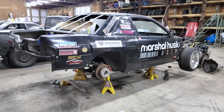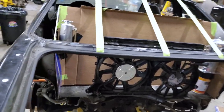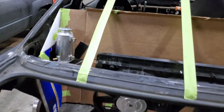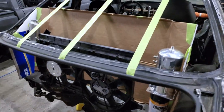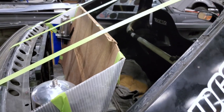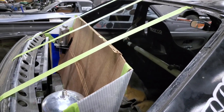I finished mocking up the firewall and I will show you that now. There are a couple of things I didn't do just because they're a little bit unimportant. This area here needs to be capped off in order to actually seal the firewall. I plan on mounting my surge tank inside of the radiator cutout along with the coolant overflow — both of them will be set on some sort of bracket built into the firewall. I just stacked the surge tank on an oil pan to get a rough idea of the height. I'm pretty happy with the way the mock-up turned out. That flange made out of cardboard will have to go all the way around, and I'm probably going to face it the other direction to mount the window so it gives more material.